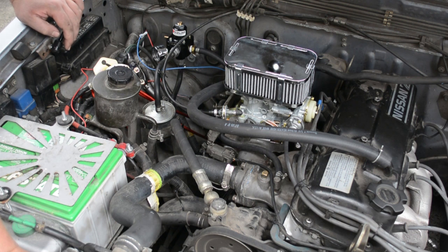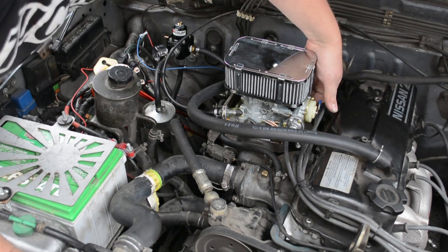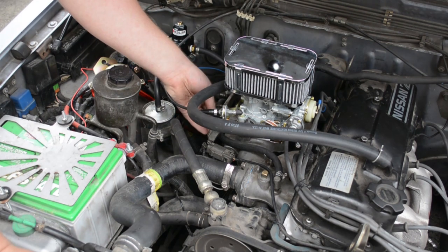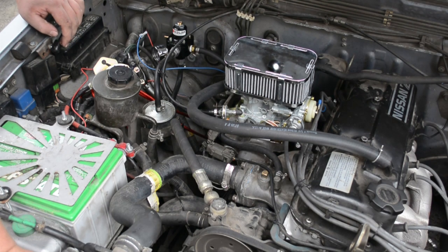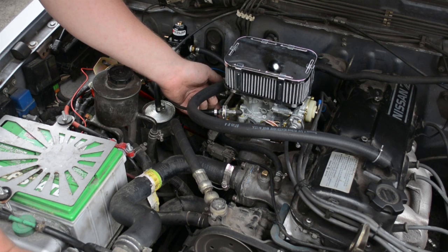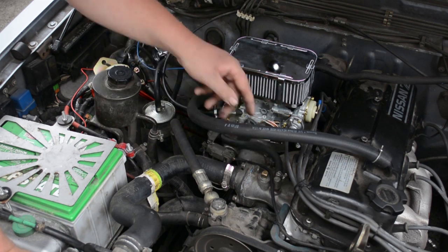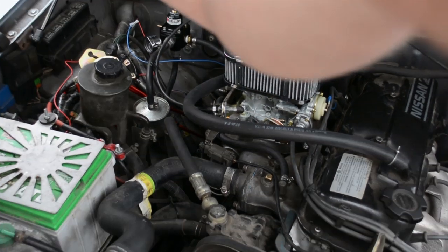And other than that, you just plug the vacuum on the carb, the one vacuum, which is back here by the electric choke. And I, like I said, spliced into the water sleeve, or the coolant where it comes through, and plugged off the left side over here. And these don't need any. I actually had plugs on these two little guys right here, if you can see them.